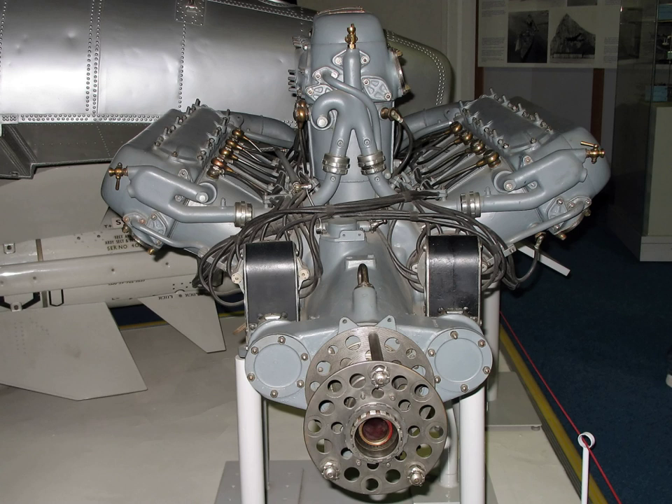A very rare type of W-engine was found in motorcycles of the MotoGP class prior to 2003. These are two-stroke, 500 cc V engines with two banks of two cylinders and two separate crankshafts, one per bank of cylinders, thus constituting a sort of W-form. The angle between the banks varies from 60 to 75 degrees. This type of engine should not be confused with the U-engine, which also has two banks of cylinders and two crankshafts, but which is made by combining two similar straight engines. The U-engine lacks the advantages the W-form engine has in terms of width and weight.